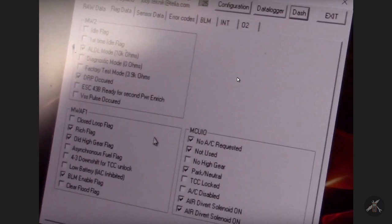The proper adjustment is in the service manual. You have to go from closed throttle — there's a button you push to release the tension on the cable, start at zero throttle, and stroke it to wide open, and then the ratchet should pull out. Essentially what you do is set the cable position with the throttle rotated all the way to wide open. The cable setting is strictly based on going from an idle throttle position to wide open throttle and stroking the cable that many millimeters to get it set.